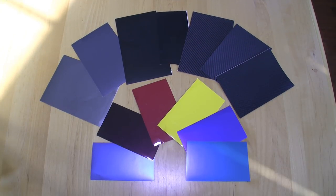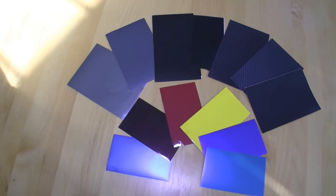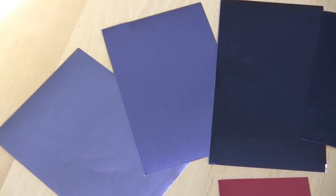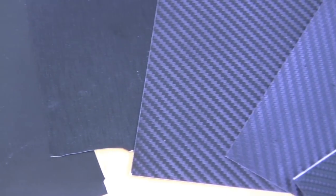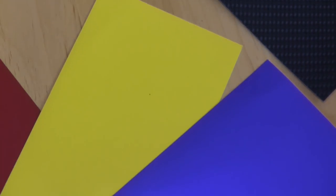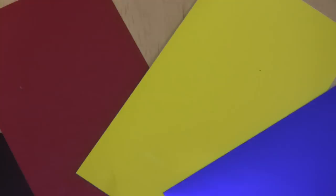One of the first choices is to do a vinyl wrap or a paint protection film. The vinyl wrap can change the color and texture of the surface, while the PPF will offer a glossy or matte finish that leaves the original color to show through. I chose to use a black brush steel vinyl by Vivid. Another good choice is 3M 1080 vinyl. I purchased a 1 foot by 5 foot roll for only $5 on eBay. Other popular choices include carbon fiber or matte black.